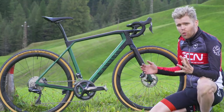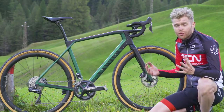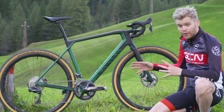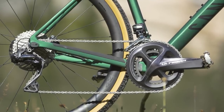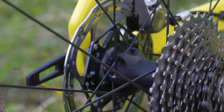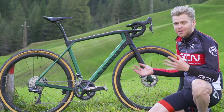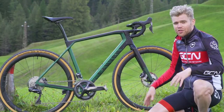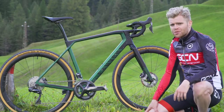Because you're likely to see a wider variety of surfaces than with a thoroughbred cross bike, you need to be able to pedal at both 50 kilometres an hour and five kilometres an hour. To help with that, the Grail has a wider range of gears — a 50/11 and then a 34/34 — whereas cross bikes typically have tighter gear ranges.